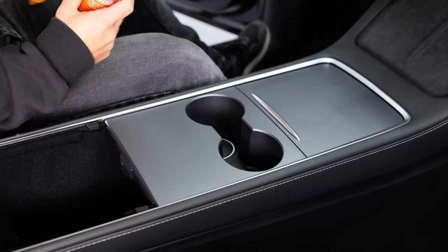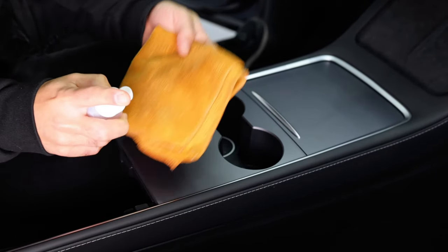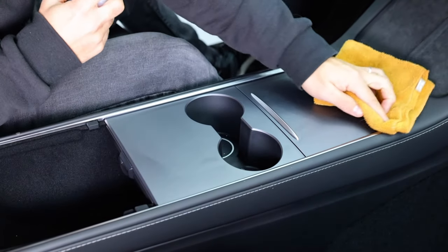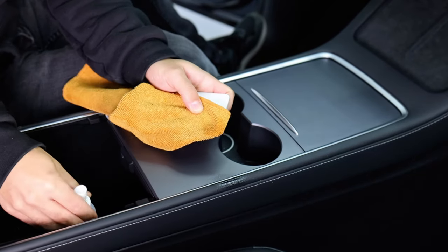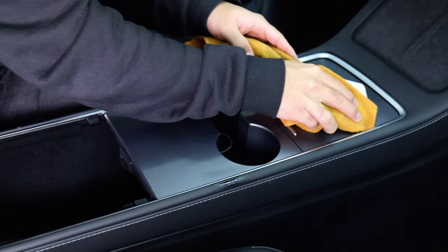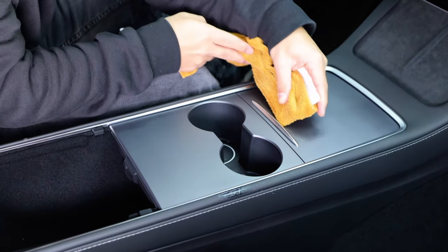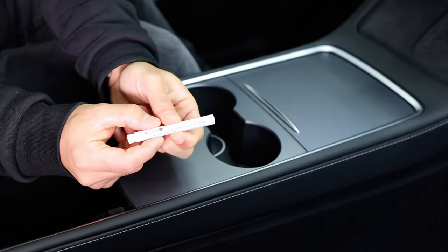Next step is cleaning. Take Rapid Prep, which you can buy directly from Our Vinyl, and spray it on a highly absorbent microfiber towel. First clean the main surface area. Then once this area is clean from all dirt and oil, place the squeegee in a microfiber towel — the hard edge can be guided along the outside area for a nice deep clean, which is absolutely essential for long-term hold. Do a 360 around the outside and any raised objects, in this case the handle on the cover.